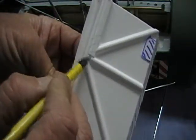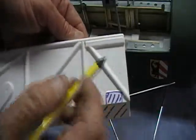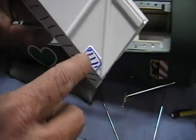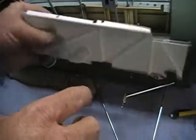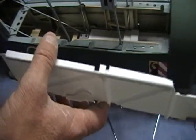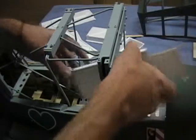Come up even with this square piece here — the whole reason I cut that out is to get you in and up underneath the dash, because this goes forward. We're going to leave this top on for a little bit and remove this section, so it's one flat piece all the way around. Remove this area so it goes over the bulges in the floorboard. When you get it done it looks kind of like this. I've made a notch for this stringer right here, for the wire here, and for this one too.